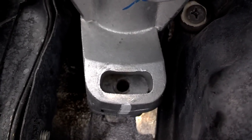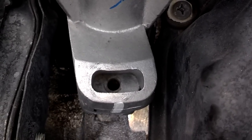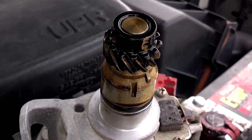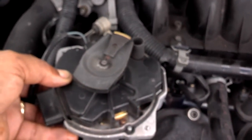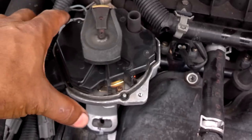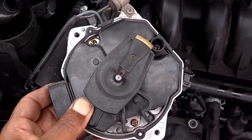I removed the 12 millimeter bolt from the base of the distributor. I can remark that to the hole as an extra precaution. Now there's the black mark I put on the housing — I'm going to grab the distributor and work it up and off the engine. The bottom part of the distributor has gears and teeth, so when you lift it off the engine the rotor is actually going to rotate. You want to see the position of that rotor when it comes off so when you slide the replacement one back down, you can match that rotor orientation.